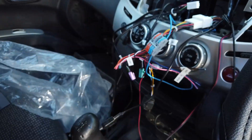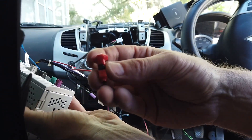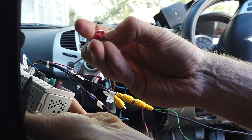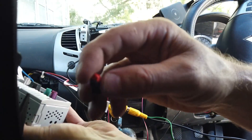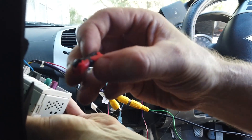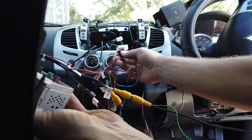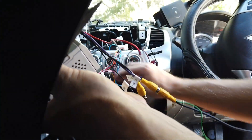When you turn on the key it goes blue — that's how you test it's all powered up. Run the cable along and up behind there. We do include small tap connectors in the kit — the red and black from the USB go into here, crimp it like a Scotch connector, T-tap into our red and T-tap into a ground.